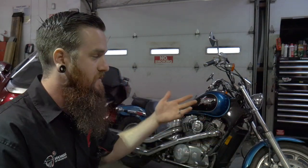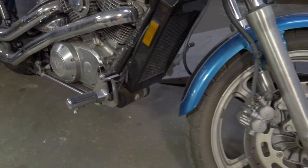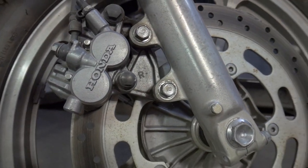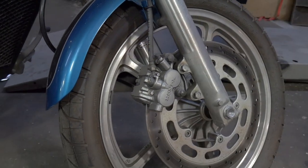This is a little bit different story. This 1100 has front brakes and it's been sitting for a long time. I got the bike running, tires are good, but when I started to ride the bike I noticed it felt like the front tire was flat — hard to push, really hard to push. The front caliper began to seize and lock up, not releasing from the brake rotor, which could cause major damage. It gets hot enough, the rotor gets warped, brake pads get glazed, and then it's no longer usable.